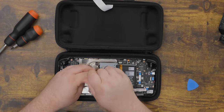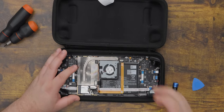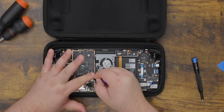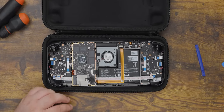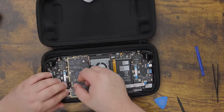FX Technology provides excellent instructions on their website, which is a really good thing because replacing the screen requires digging further into the Steam Deck than ever before. After removing the monoblock, we disconnect the battery, remove the upgraded SSD, and unplug the fan — our order of operations here may have been non-ideal. Next, we disconnect the speakers, then disconnect the button board before unscrewing and removing the motherboard. Watch out for the audio cable on the back.